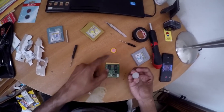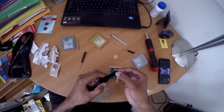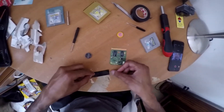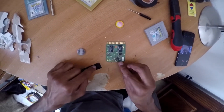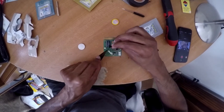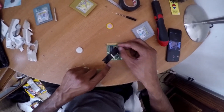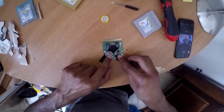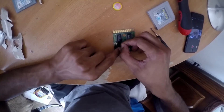So the positive side — we're going to put it on the same way the old battery was, positive side face down. What we're going to do is take a little bit of electrical tape — that might be just enough right there. We're going to bring this arm up and put the tape under it. But before that, let me take some time to try and straighten this arm down without breaking it, so the cartridge will close and fit like it originally did as much as possible. Try not to get debris on your electrical tape — it'll make it so it doesn't stick as well. So take the positive side battery, put it face down, bring the other arm so it's touching the battery and flatten it out a little bit, bring one side up, tape it, hold that down, bring the other side up and over, tape it.